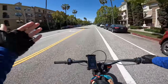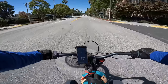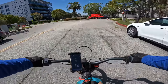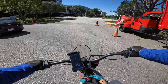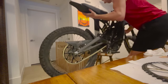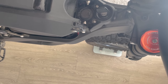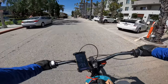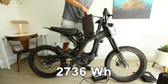When I'm riding I only ride on nine because you have access to all the power with the throttle. You don't have to use it all but you can. On this Z-Bike we have access to about 12,000 watts of power. I don't know exactly what the bike weighs but I think it's about 120-ish pounds. On the scale it's showing 71.4 on the front and 66.4 on the back — wow, 137 pounds total. A lot of that is the battery which has about 3,000 watt hours of energy.